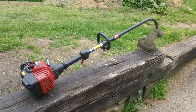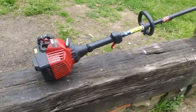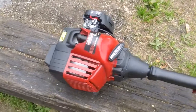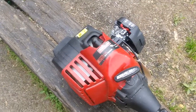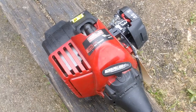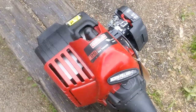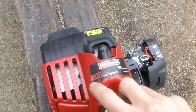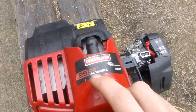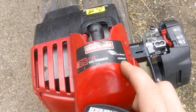Hey guys, Chris Beckham, CNH Simology again. I've got another quick video here for you guys today. This is a tried and true Sears Craftsman string trimmer. It's a 25cc engine that powers this machine, and it takes a 40 to 1 mixture ratio. They even have it embossed on the actual identification tag — 25cc gas string trimmer on one side, and 40 to 1 fuel mixture on the other, where they also call it a weed whacker.